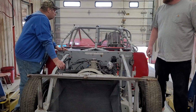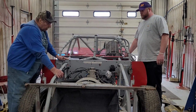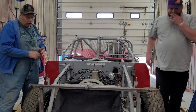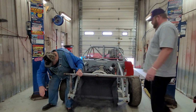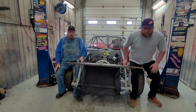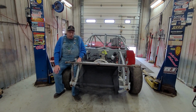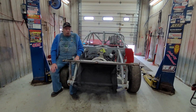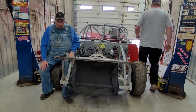Okay, let's hit that starter and see how hard that kicks there. That's about normal, that's all they do. Okay, distributor's locked out, guys. And what that means is it's got no vacuum advance and no mechanical advance. This is generally a circle track setup. And so whatever you set your timing at, 2000, it's gonna be that way right on up through your range.